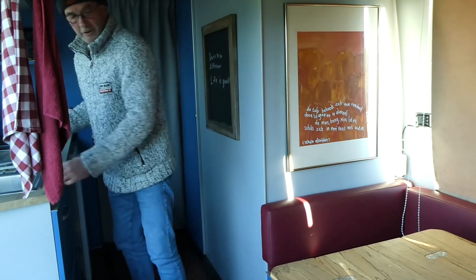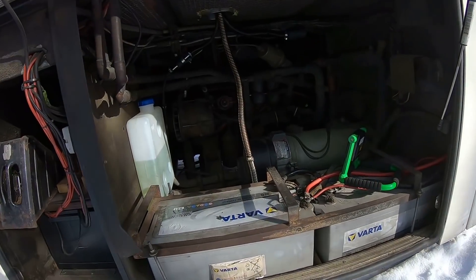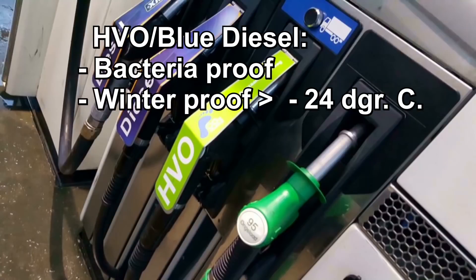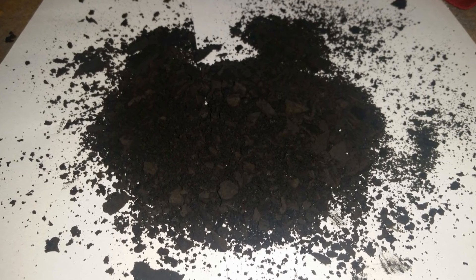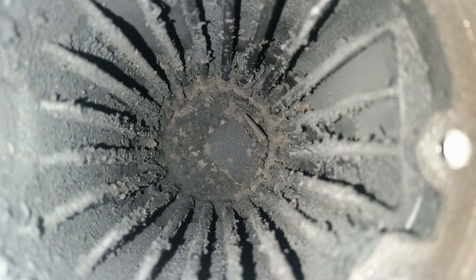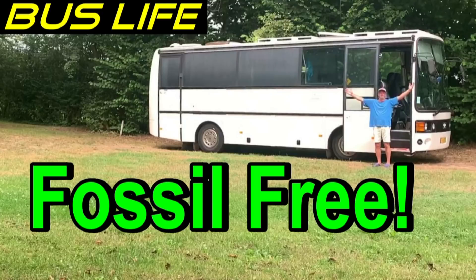There are two more things I want to share with you. First one is the diesel. My fuel tank doesn't have conventional diesel in it, but HVO - also known as blue diesel. This stuff contains less aromatics, polyaromatics, and sulfur - the products responsible for soot build-up. So this stuff will help you make your diesel heater burn a lot cleaner, and it can be the difference between a clean and a dirty result. If you're interested in blue diesel, just tune in on my special video about it, which you can find in the description below.